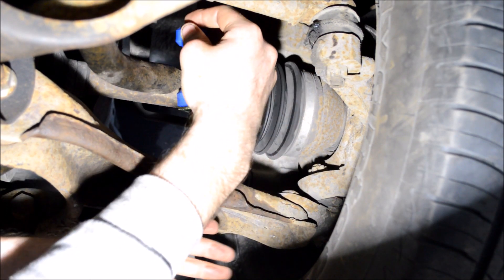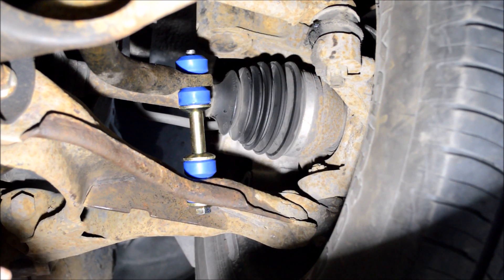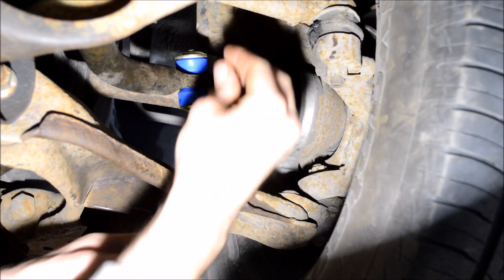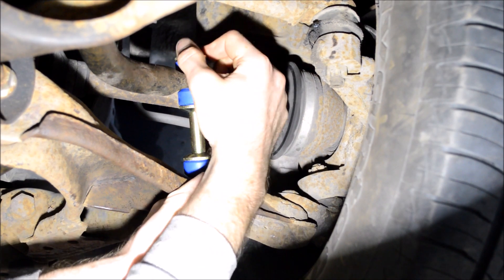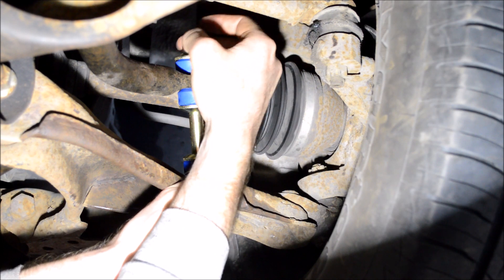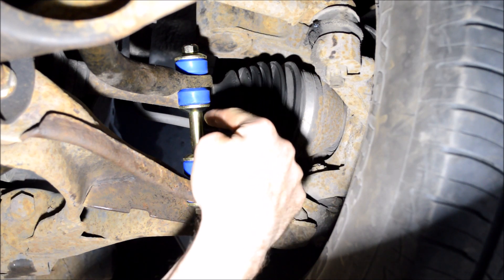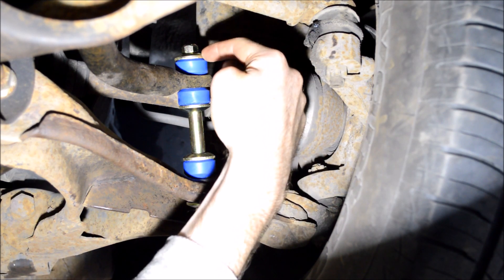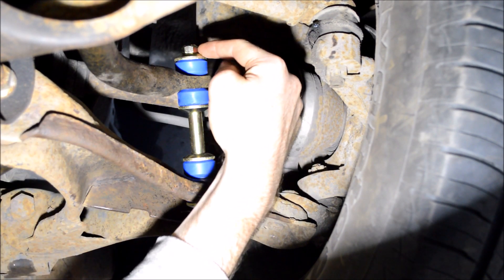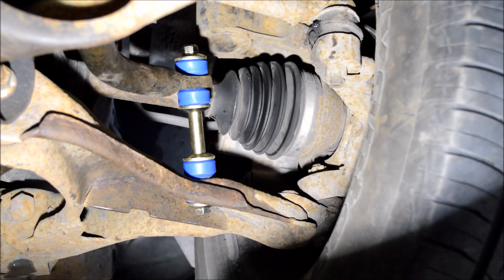Now for the fourth final rubber and the final washer, and then finally the nut. I'll just get that started, and then I'm going to put on the sway bar link on the other side before I tighten this one down — so that way I have slack to move the sway bar up and down still. I might have to take that nut and the top stuff off too so I have more slack. Let's go to the other side.